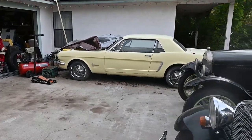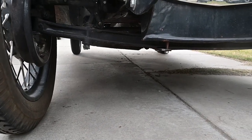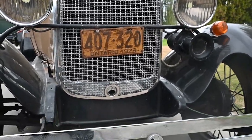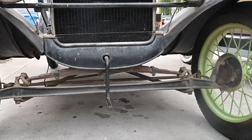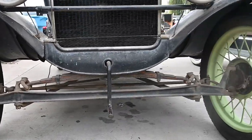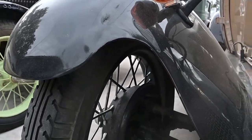Looking at the chassis — you can see going under the front axle that it has a little bit of a curve to it. They dressed up the front end a lot more on the A, so you don't see all this spindly action. You notice that front leaf spring, the straighter axle, and — no front brakes on the T. There are no wheel service brakes on this car; it's all the transmission brake, whereas the A had modified wheels so you could have the brake drum there.